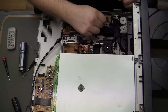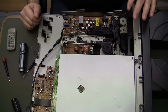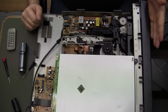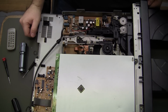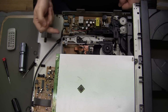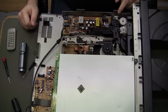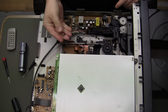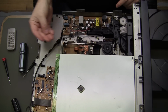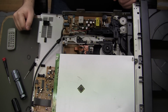Super weird. I don't know why the button is not putting the big disc out, but the large tray still is binding somehow, but I'm not sure if it's not because the faceplate got smashed on this one. And it's just hitting somewhere or something. I mean, just as soon as I touch it, it's out. Plus I still have the original old belt on here, which may or may not be getting enough friction, but it's chewing up my little rubber bands. Those are kind of useless here. It's almost too much friction.